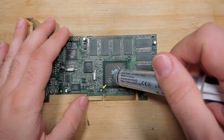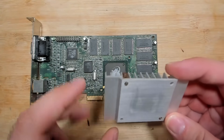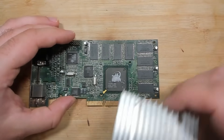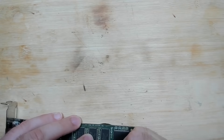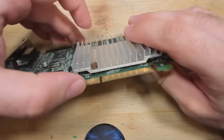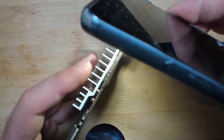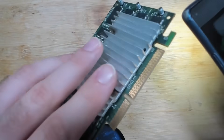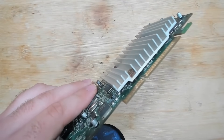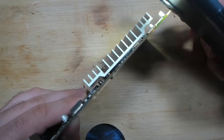We'll use a little bit more thermal paste — it will squeeze out on the sides, but you'd rather have too much than too little. The heatsink is also clean, but it is not smooth — all the gaps will be filled by the thermal paste. Both prongs are through the card and the heatsink is back on. Let's see if we can see some thermal paste — yes, now we have enough. There is still a gap between the aluminum heatsink and the plastic housing of the chip, so let's press it down a little further to make nice contact. We squeezed more out, but now the chip is nicely attached.